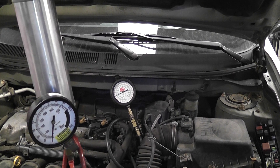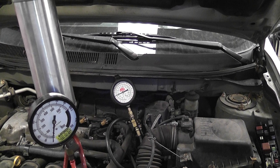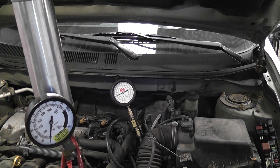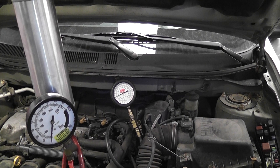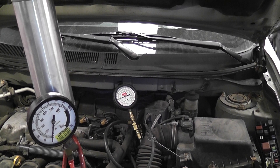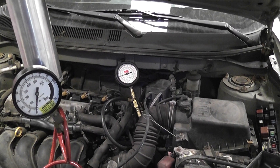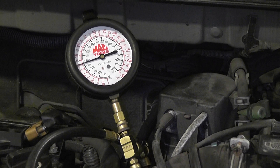This part's important to make sure you do it right. We pulled a wiring diagram and we're going after a relay called the circuit opening relay, which is a fuel pump relay on a Toyota. I know this isn't technically a Toyota, but the engine is. I'm going to disable this relay — just unplug it. The relay is unplugged. We don't want to just take for granted that unplugging the pump relay means the pump won't run, so we're going to start the car and make sure our pressure on the gauge drops all the way down and the car stalls. That's what we want to see — go ahead and start it.